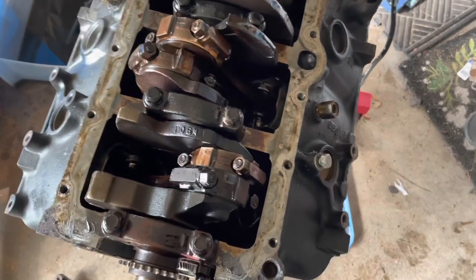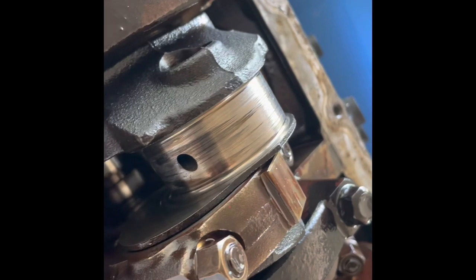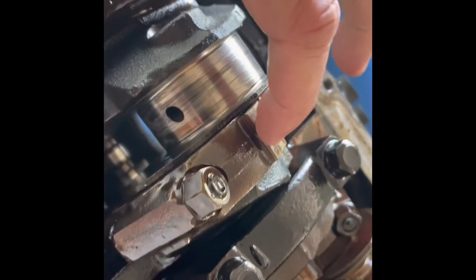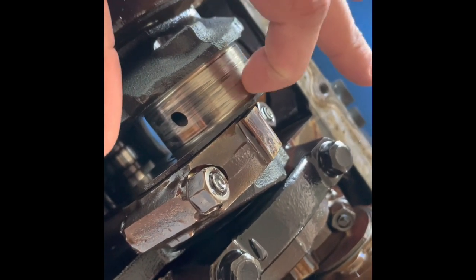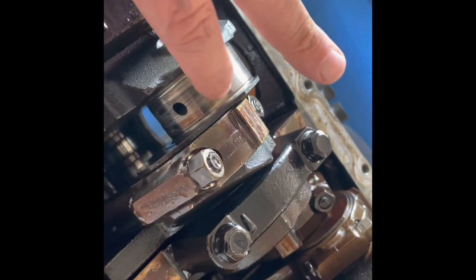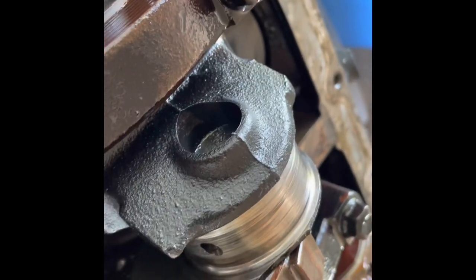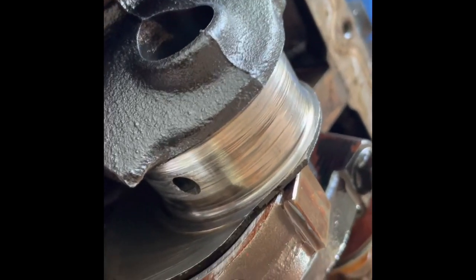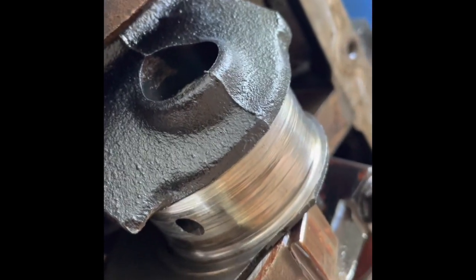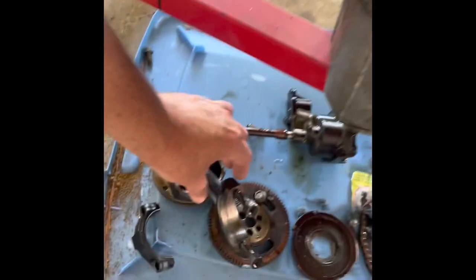We now have the number one piston taken out of the bore and the crankshaft journal is visible. You can see there's quite a bit of scoring here - I can take my thumb and feel mountain ridges in that journal. You're not supposed to feel anything with your finger at all. It scored down this crankshaft pretty good. I'll have to take a caliper to it to see how much metal is left, but a lot of times it ruins the crankshaft when it gets like this because you've got metal on metal.